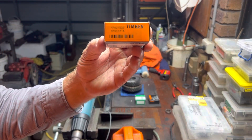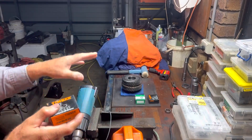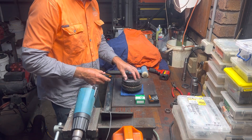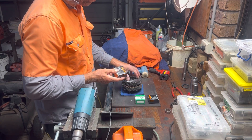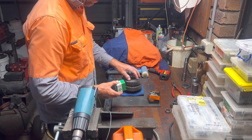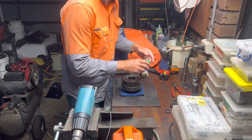I've also pulled these 33205s but I prefer to run the heavy duty ones. They're exactly the same physical dimensions - they fit, there's no issue. They're just a higher spec for a harder working bearing. I think the LT230s are a really good design, they last and cop abuse, but these bearings do cop a bit of work. I also have my needle roller bearing, the same as the one that was in there. They're clean, open, just put back in boxes to keep them from getting dusty.